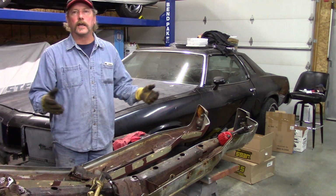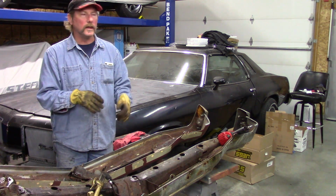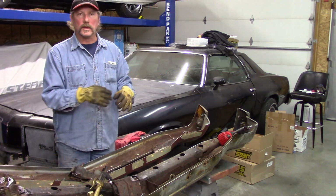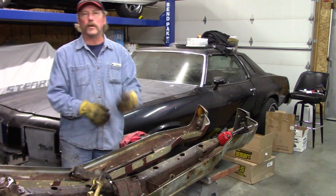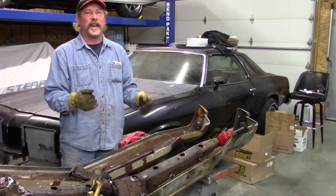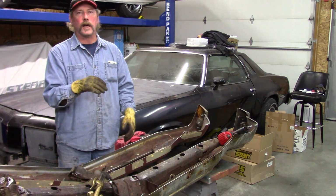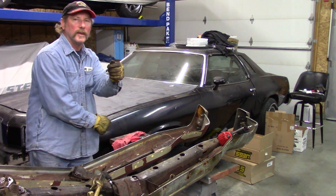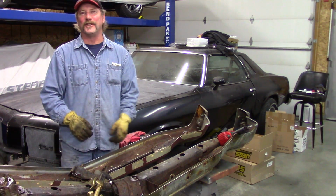In 1970, they had computers where you could put in all the parameters of that car, tell what they wanted to get out of it, and these computers would design the suspension points and the thickness of the sway bar and stuff. When you had these long cars like this and you went around a corner, the tail end would hang out, you'd be cross-turned, you felt like you were Joe Racer. And then as cars got shorter and shorter, like little Mustangs, you go around a corner and you hang the tail end out, and a lot of times it just swings you right around. Well, with the longer wheelbase, you had time to bring it back into control, and you'd fishtail it one way and fishtail it the other way. And it felt really cool.